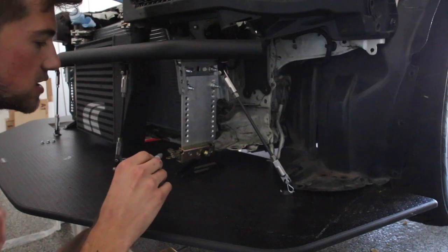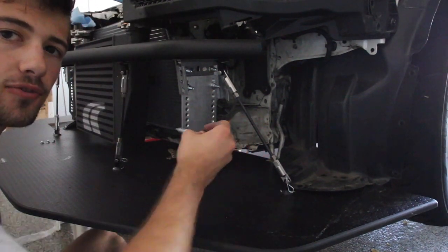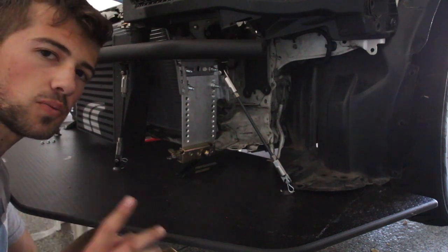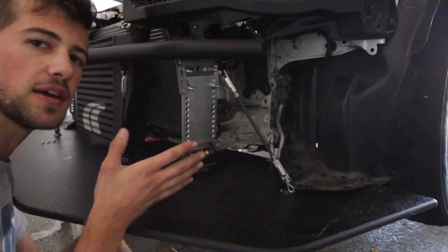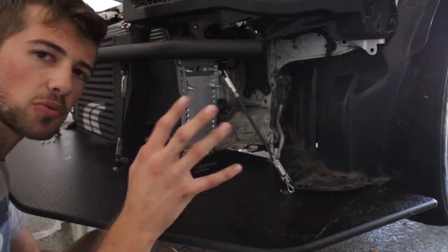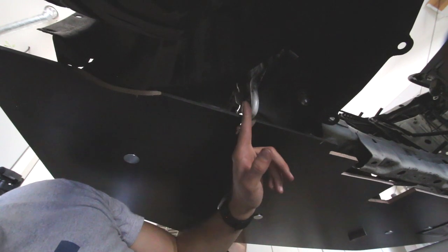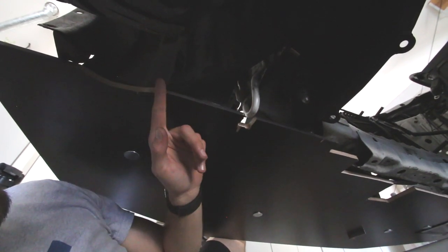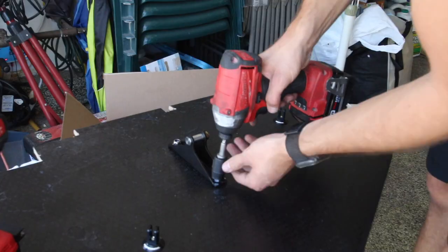With the splitter mount in position, I use a sharpie to mark where I need to drill holes to attach the bottom plate — I'm only drilling the outside corners since it doesn't need all four points, though all four are available for high downforce applications. Before removing the splitter, I also mark where I'm going to install the splitter diffuser. You want the diffuser to feed into the wheel well — generally the inside part — so the air has somewhere to go. Looking underneath the splitter, I can see the wheel well area and I'll be installing the diffuser between the tow hook and the existing cutouts. I then removed the splitter rods, drilled the holes for the mounts, and mounted the splitter mounts.